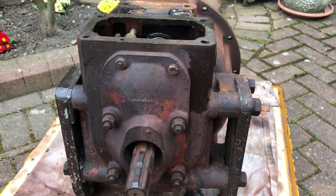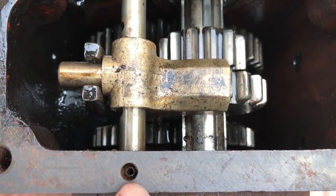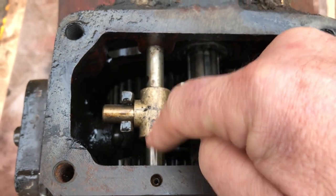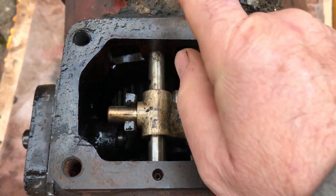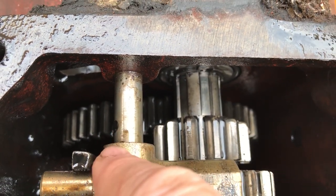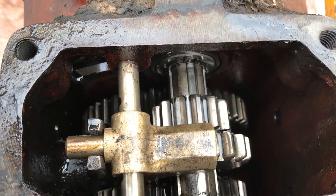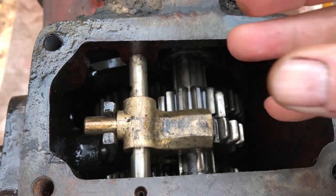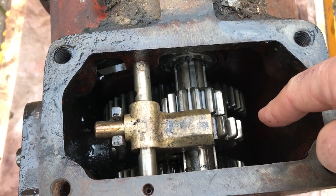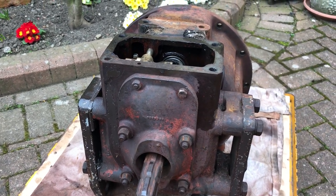First job today — rear cover's got to come off. Then we've got to go down this hole. See the hollow pin in there? Looks like a roll pin. Well, that pin's got to come out because it's holding the selector shaft in place. The selector shaft's got to go that way — out. Your detents — see the groove in the shaft here? This is where your detents fit in. The detents are in this part of the fork. There's a spring and a ball that push up against the shaft. So the shaft's got to go that way, the fork's got to come out, and the spring and ball you've got to try and catch. Then we'll take the shaft out of here, then we'll take the bottom shaft out. Job's a good one.